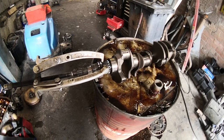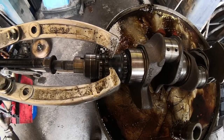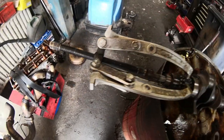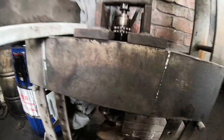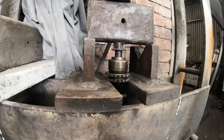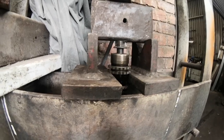Okay, back from the house. It's the smallest puller I've got - a bit overkill but as you can see we're behind the teeth on the crank bolt. Hopefully tighten that up, should pull this piece off. Scrap that idea - worked on the M62 crank but obviously the M60 crank's a bit tighter, just kept spitting the jaws off. So we'll press it off - not scared about the crank falling, it's scrap anyway.